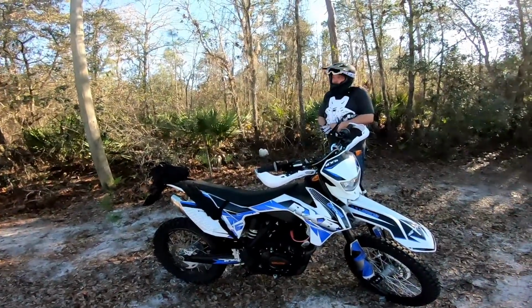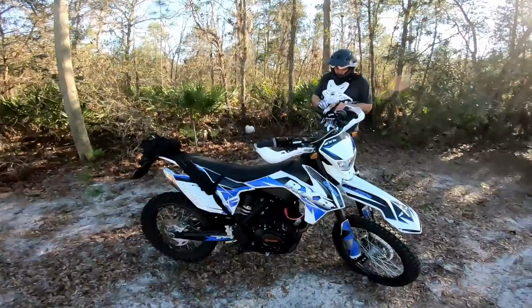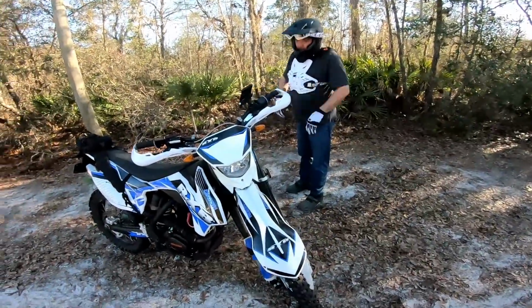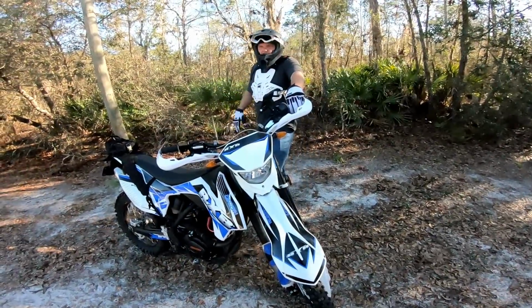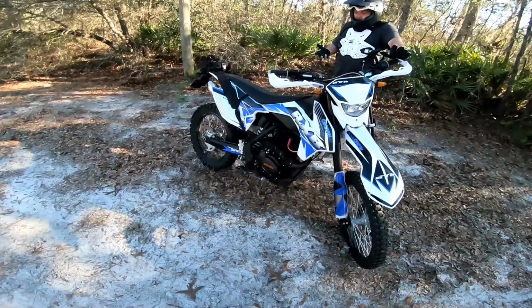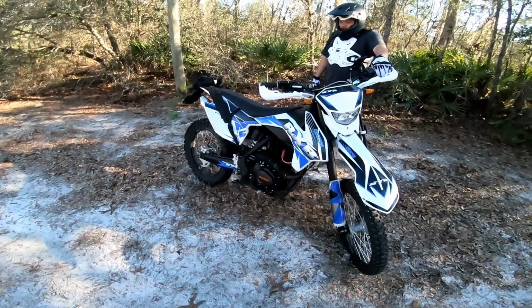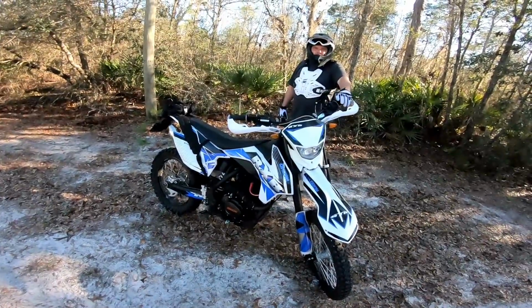I've had the Nibbis and I've had the Okos, and I almost like the Okos for the price. I put a Nibbi on my wife's 150. I bolted it on, quarter turn on the air screw, quarter turn on the idle, read the plug after about 10 minutes. I've never touched it since. Nice. I jetted up to a 135 and went to a 42 pilot just because I don't like pulling. You're running 135 in that?